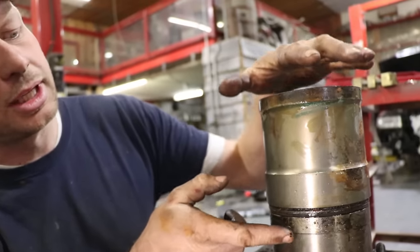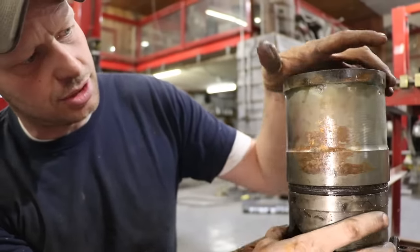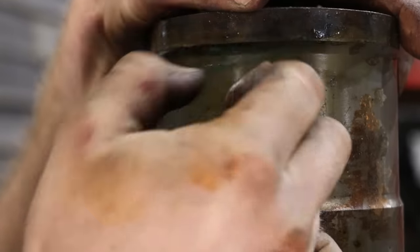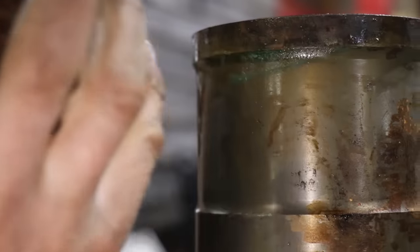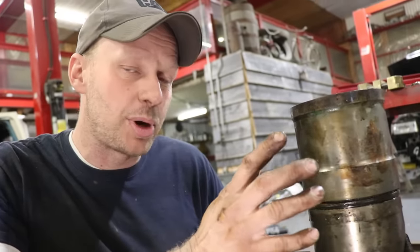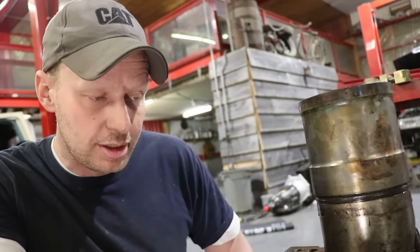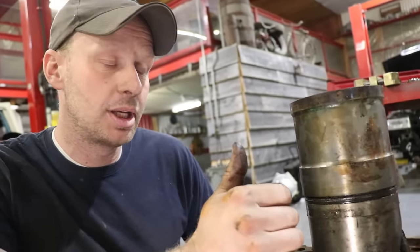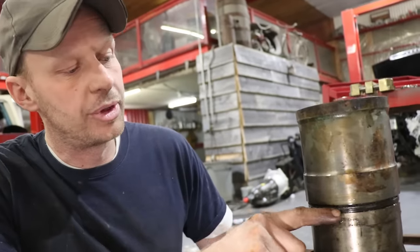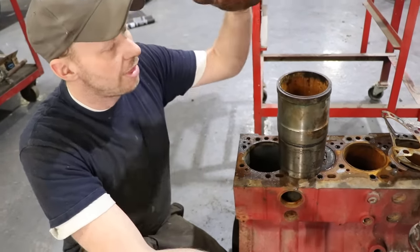You would see pit marks in between here and here. Your O-ring separates your coolant on the top from your oil on the bottom. If there was cavitation, you'd see the SCAs from your filter — that's kind of what it would look like. You'd be able to scratch this off, and when your piston is rocking and imploding, because there is nothing there behind it, it would take this green stuff off and not take the steel out. If you follow the proper steps in assembling a wet sleeve, you shouldn't cut the O-ring and you shouldn't have any issues of water leaking into your oil. Before we put the oil pan on, we'd always bolt the cylinder heads down, fill it up with coolant, and pressure check the cooling system, usually overnight — up to 15 psi, whatever the rad cap recommended. Come back in the morning; if there were any drops down below, then you definitely cut the O-ring. Smart thing to do before you put your oil pan on and assemble everything.